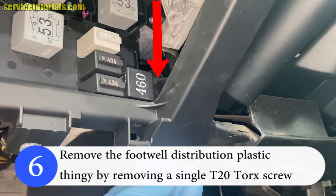Remove the clamps from the two heater core hoses using a T15 torx or a 5.5mm socket. There is an easy way to separate those pipes: cut those two pipes from the heater core using an electric saw at a distance of 3 or 4 cm from the joint with the other pipes.